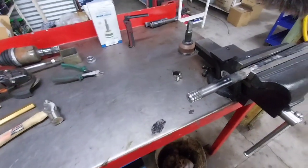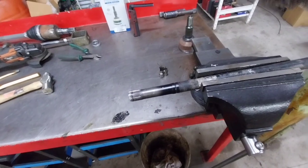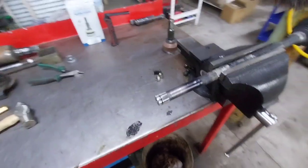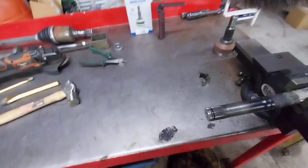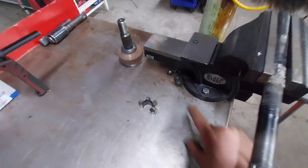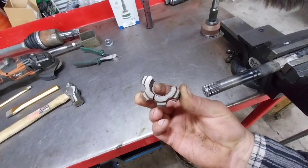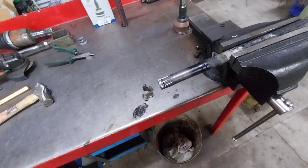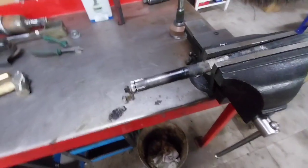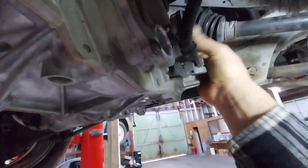Some of that might have looked a bit brutal - unfortunately sometimes you can hit them off with a hammer and they pop right out, but that's only about 50% of the time. In this case it didn't work, so I had to cut the cage around the CV joint, remove the balls, and then slice the center section into three pieces to separate it. Not ideal, but sometimes you haven't got a choice. Now we'll see what happens with the length.